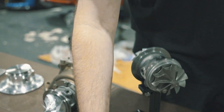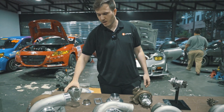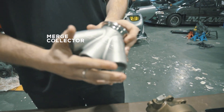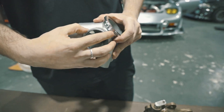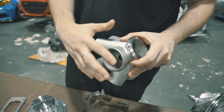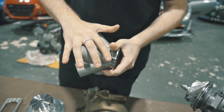This is what you'll get if you order a V-band. You could also go a step further — if you're making your own manifold or having one fabricated, you can order a V-band merge collector. It's a cast piece, also made here. It has an exit for a 60 millimeter wastegate. You can put a reducer if you need a smaller wastegate. We also have these in T4 and T3 as well.